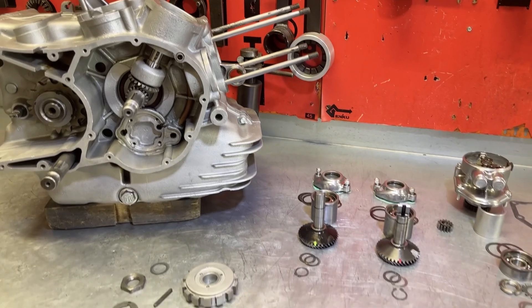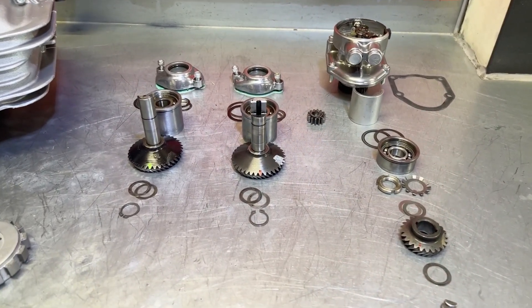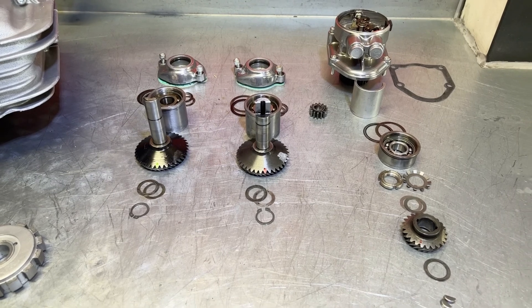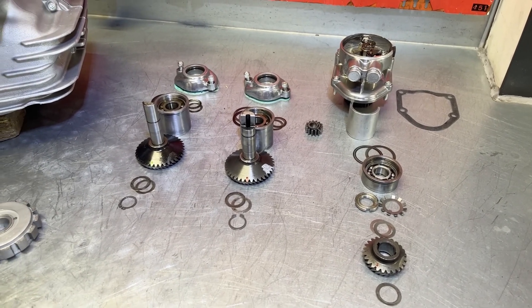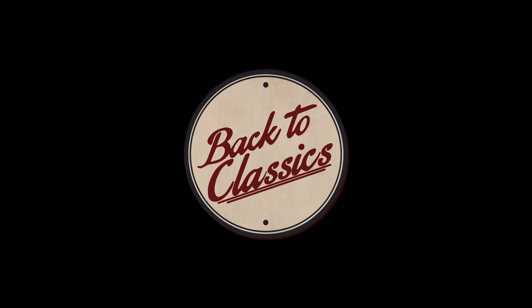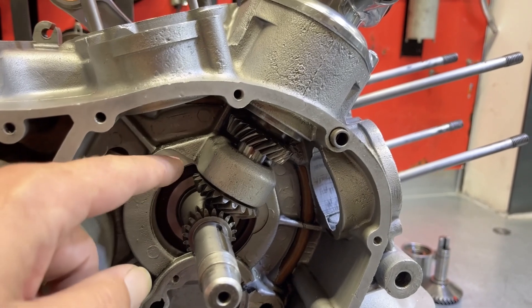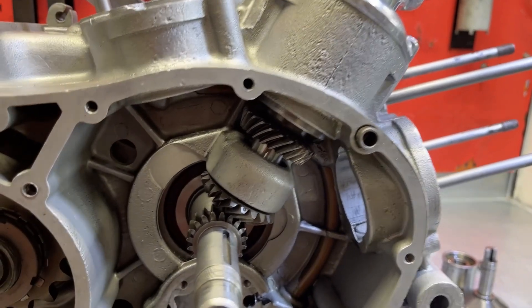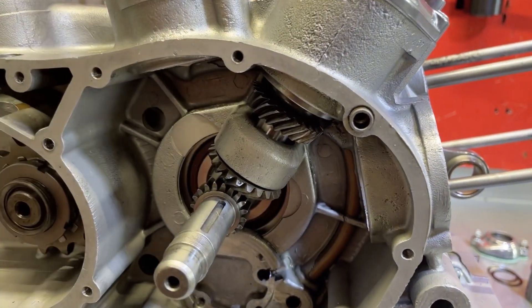Now for one of the main events on the 750 round case rebuild: the distribution system comprised of many bevel gears that all need to be set up and shimmed correctly for it to turn in the correct way. That's a whole package of shims, bearings, and bushes that we're now going to fit together, starting with the center bevel gear. The whole job was to get this entire setup at the correct height in reference to the gear that slides over the crankshaft — now all set up and tested with all the rest of the gears in place.